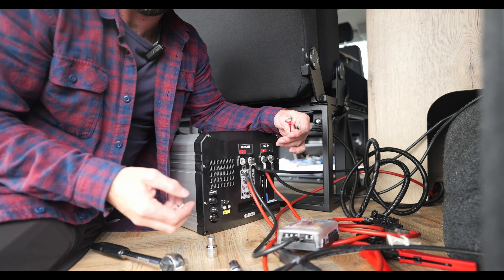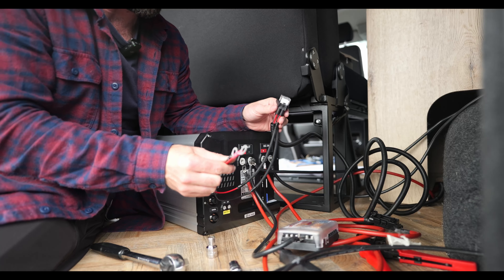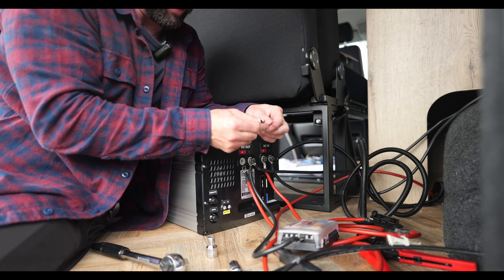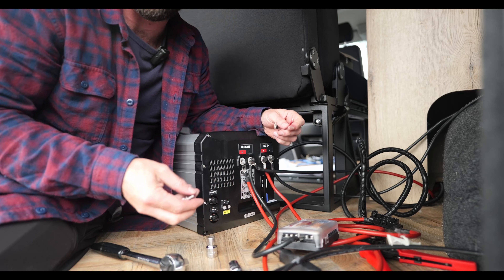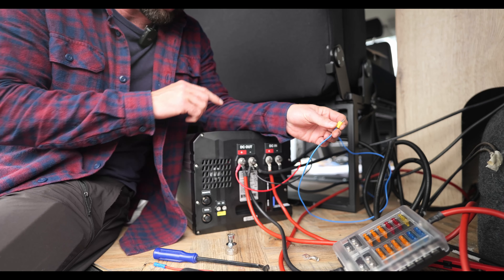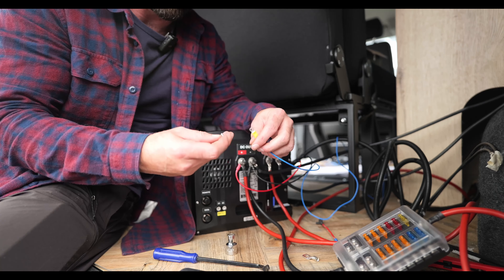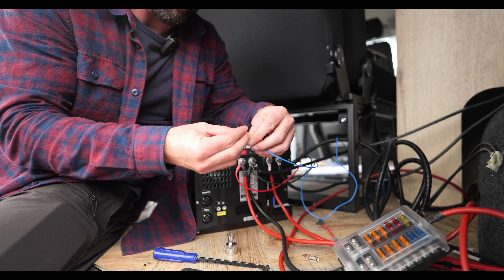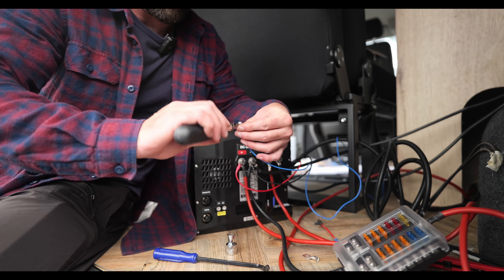Because I've got my diesel heater which is fused, I'm going to attach the positive and negative directly to the positive and negative on the unit as well. Next up we need to connect the engine live, so that's to tell the unit that there's a power connection and that the alternator is running. You'll use the provided screw and a T20 Torx bit and connect it to C1.